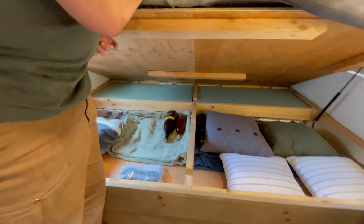So inside this wall, which is underneath the shower bench, is our power distribution center. We have our 110 volt and our 12 volt distribution center. The heart of our power system is our Victron Multiplus 3000 12 volt system. We decided to do a 110 volt apartment size refrigerator. And it's worked really well. We routed all of our systems to this command center.